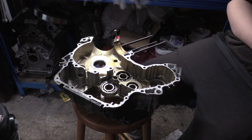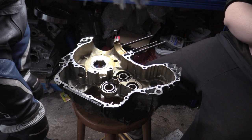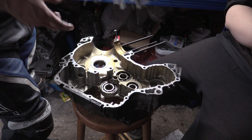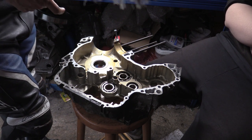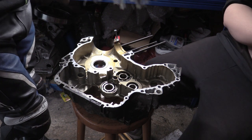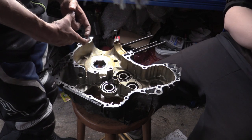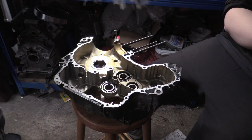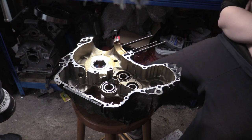So what we need to do is, you can hit the inside of bearings. What happens is the inner race moves down, so you whack it and it goes down. It has to bring the whole bearing out, so the balls get loaded with side load, thrust loading, axial loading, and then the balls transfer that to the outer race. The problem is you've got a ball in between, so what you really want to do is hit the entire inside of the race.